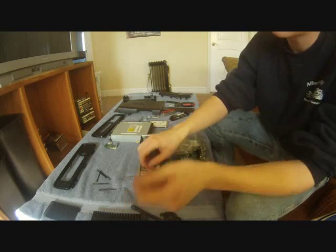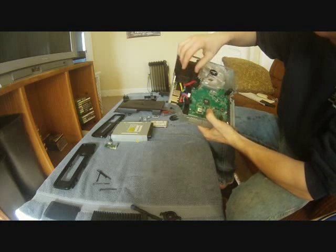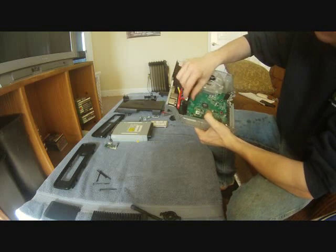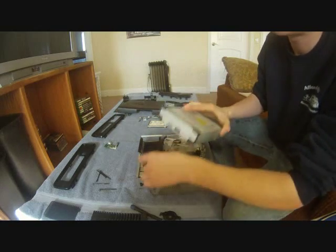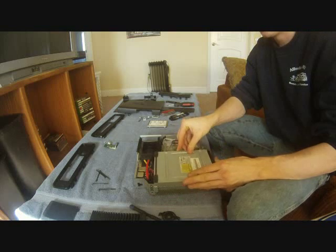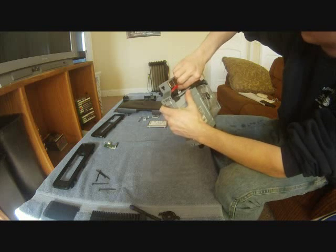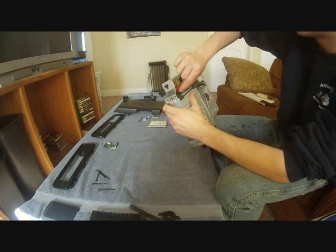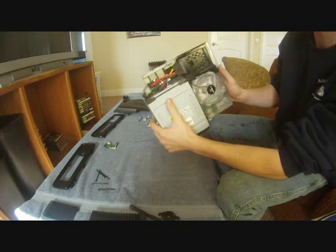And like I said before, I didn't unplug this one right here, so I remembered which port, because you can actually mix these two up right here. But this one goes over the top, the farthest one. This one goes underneath, right there. That attaches to your disk drive. You take your disk drive, set this back down in here. Just kind of look at the back. It's a tight squeeze, but you can do it. Plug that back into there, into there, and that's what you should ultimately look like.